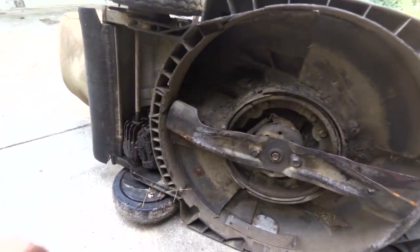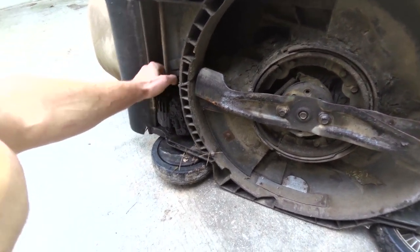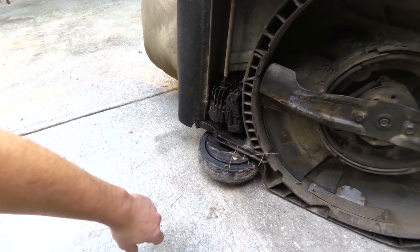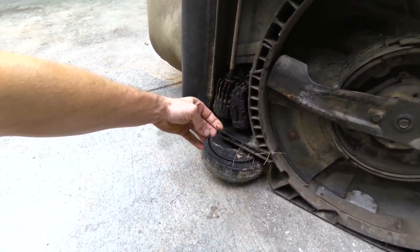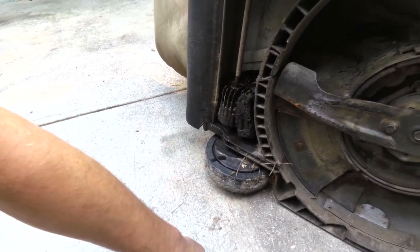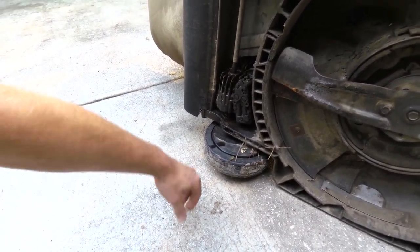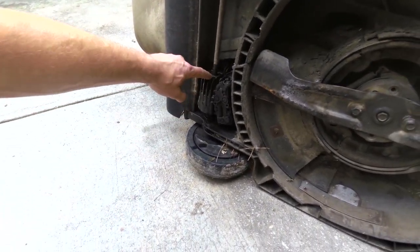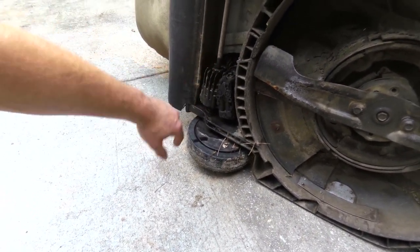It still works a little bit, but it's starting to pull slower and slower. If you ask the internet, it talks about how this is a legitimate hydrostatic transmission inside of these things, and it's only got a couple of tablespoons of oil in it. When it starts to leak, it doesn't take long for the thing to completely leak dry, and then the guts wear out. I guess if you catch it early enough, you can put a set of seals in it, at least around the two axle seals.